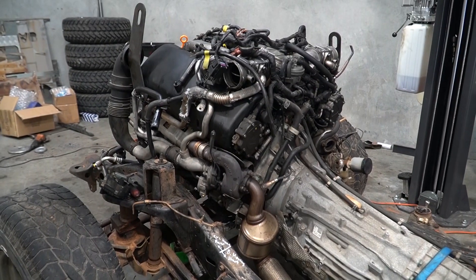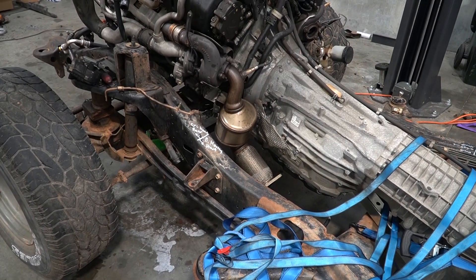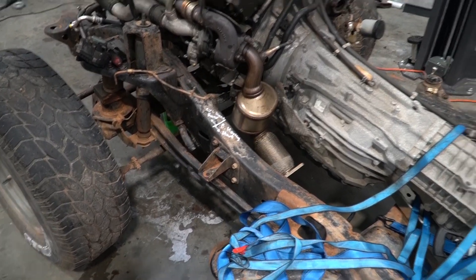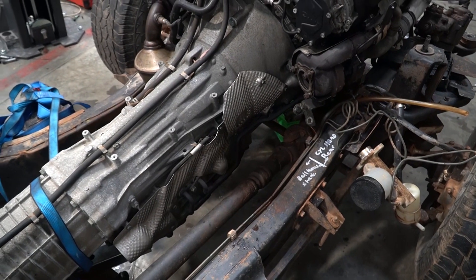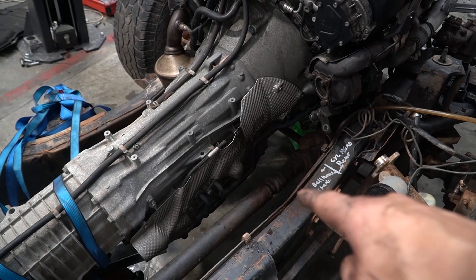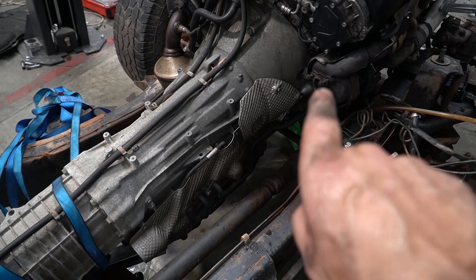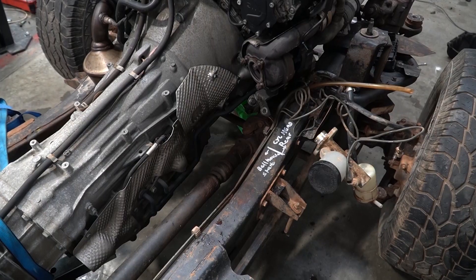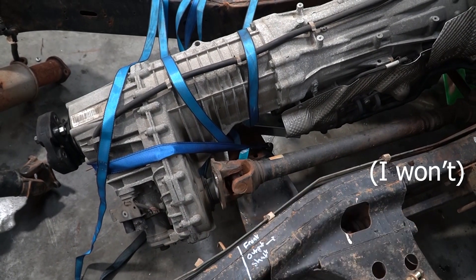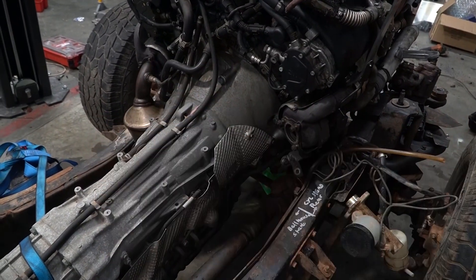Now as with anything, this thing didn't fit perfectly, funnily enough. I feel like this exhaust is going to be okay on this side, because there's plenty of clearance. According to engineering guidelines, you need at least 10mm all the way around, and I've got about triple that. On this side, I'm probably going to have to do some tricks, because originally this exhaust comes down here and goes on this side of the drive shaft, which isn't a problem on an IFS vehicle because the shaft is straight and never actually moves. However, on a solid axle you've got everything moving up and down, so it will smash into the exhaust. So what I may end up having to do is bring it straight across and across the back of the transfer case here, which is probably not going to be easy. The other alternative is to wrap it over the top, but that's clearance dependent.